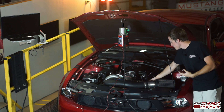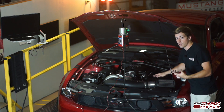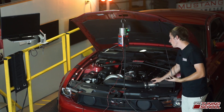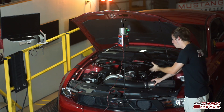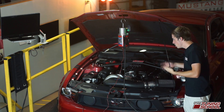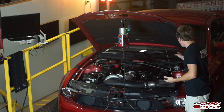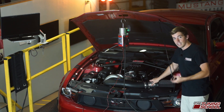Our mass air flow sensor is a blow-through style, so it's mounted way down in the charge piping leading to the motor, so it'll be okay. With this car, it's a boosted car, and for boosted cars there's a lot more places to leak. So you kind of want to maybe get under the car so you can see all the piping — there's lots of rubber couplers, lots of places for it to leak. So boost reference at the brake booster, and then cap at the filter, and you're good to go.